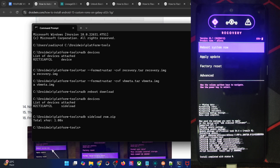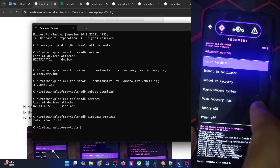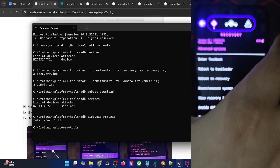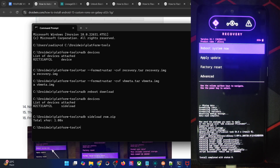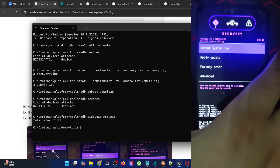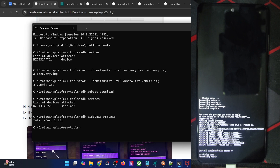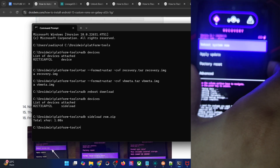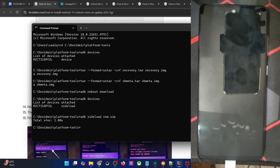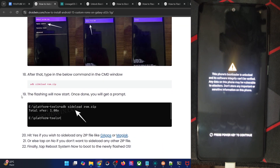The flashing is now complete. If you want to flash any other ZIP file, first do a reboot to recovery from the Advanced options, then do an ADB sideload of the required ZIP file. Once that is done, your last course of action is to do a Format Data once again just to be on the safe side — select Factory Reset, Format Data, and that's it. Once formatting is complete, select the back arrow and then Reboot System Now. Your phone should now reboot to the newly flashed OS. Do keep in mind that the first boot will take some time — that is completely normal.